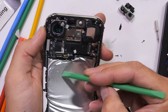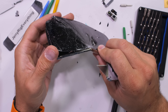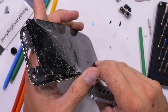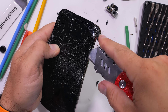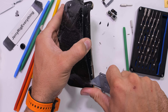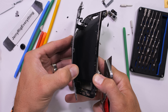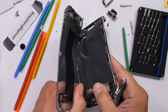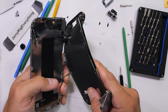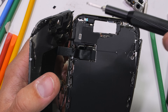The screen of the iPhone Air is also pretty easy to remove and replace. Normally I'd use a suction cup and some heat while dripping in some isopropyl, but today we're performing more of an autopsy than a repair and I'll just peel it off. There is a hefty amount of adhesive around the edges, probably to help with that IP68 waterproof rating. There's one additional tri-point screw and two ribbons holding the screen to the body. A technician could probably swap out a broken iPhone Air screen in about five minutes if they really wanted to. I'm a fan of this design.